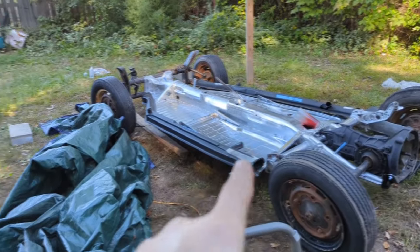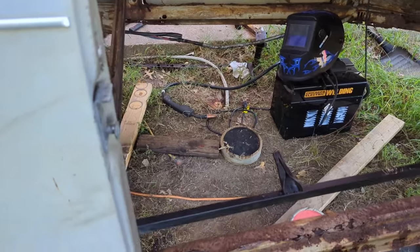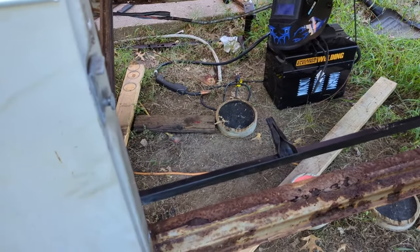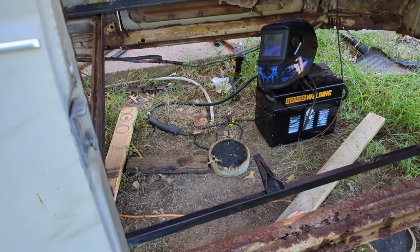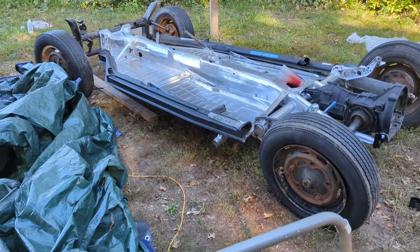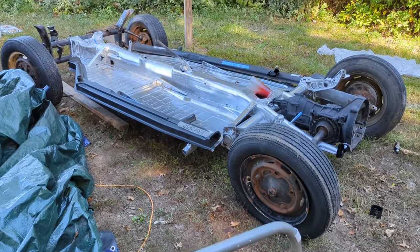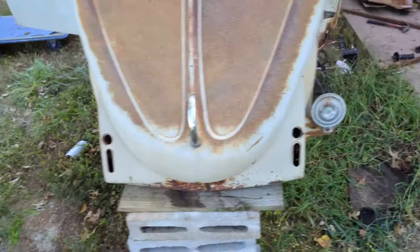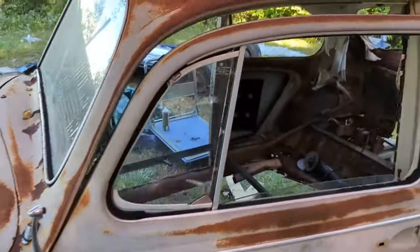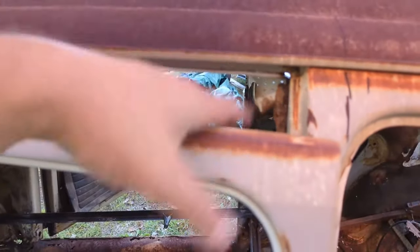Once I get those guys on there, and these removed really pretty, that thing is going to, whoop, focus. There we go. That thing is going to roll back underneath here. I'll probably do this in the garage part. We'll roll back underneath here, and I'll gently lay it down and then close the doors and adjust to my heart's content to get that thing all fitting those heater channels and then weld it in place. I've seen it done like that a couple of times on various websites, various YouTubers. So that's my plan of attack to get rid of the gap that is way too big.